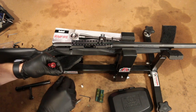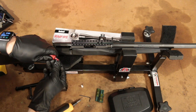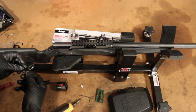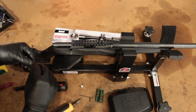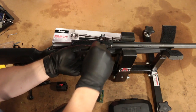That's not the lesson in torque that I was expecting to give. I was fully expecting to be giving a lesson on how things are under-torqued from the factory. But that's clearly over-torqued, and that does happen as well. There is such a thing as too much torque. And when somebody can't remove the fastener, I might not want this rail on there.